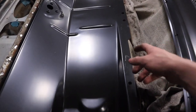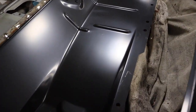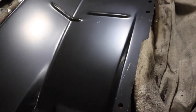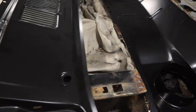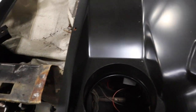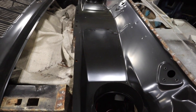So what I'm noticing on this test fit is that there's too much metal in this area. I guess that's all right, it'll give me a little room to play with, but you can see it's supposed to go in this slotted area, so I'll have to grind that down to fit. It looks like all the holes line up pretty well. Let's see what the other side looks like in that same area — yeah, it's going to need to be trimmed up a little bit. I was hoping it would be more of a direct fit, but you know how it is with reproduction parts — you have to sort of make them fit most of the time.